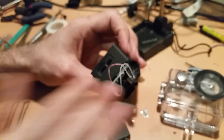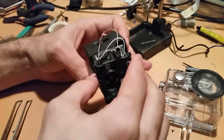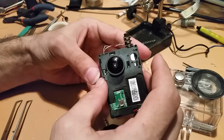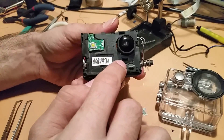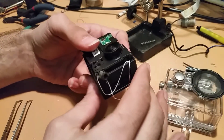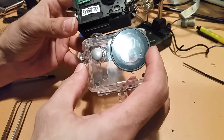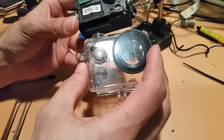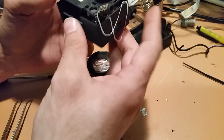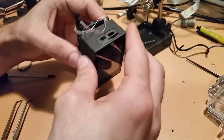You can go 2.5mm. The idea is to get this 3.5mm jack to fit inside. I intend on putting a switched jack and then putting a microphone right here in the camera at a future date. But once you put the camera inside the enclosure, an internal microphone is just going to be equally as poor as the original one, so I find it kind of moot.